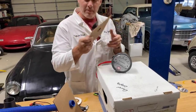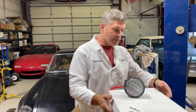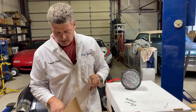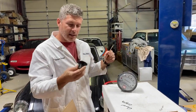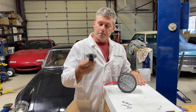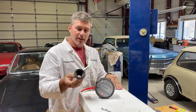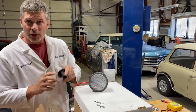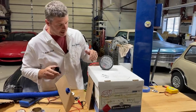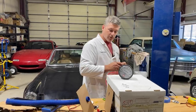Now see, I only just got my hands on this little half-size guy late in the day. So I wasn't able to finally finish setting everything up and tape it up, because this box needs to be sealed properly. I kind of poked a hole in it. Anyway, but you can see this little thing. Now that we have the airflow high enough, now that we have it scaled so the Reynolds number is... look that one up, kids. It'll be fun. But we actually were getting the airflow levels high enough to activate this flow. It's working. And you can see, in the same sort of situation that you'd have with a brake duct, you could see a measurable difference in our pressure. And I keep banging on about relative pressures, but basically the better the pressure ratio, the more air you're going to move through there.